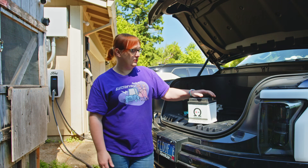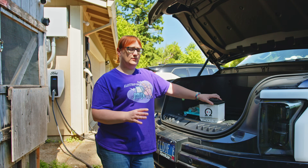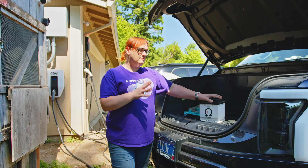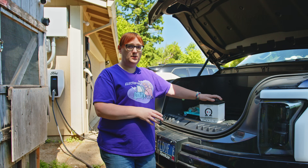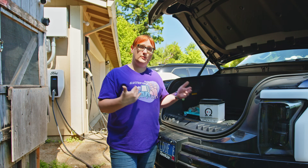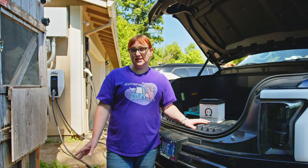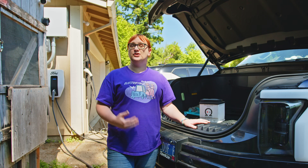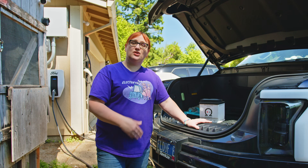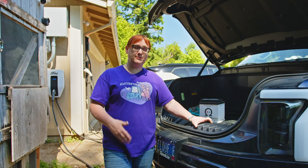It is unfortunate and frustrating that this battery died so quickly. I've also noticed a few strange quirks with this truck's 12-volt system — there have been a couple of occasions where I've got behind the wheel and the battery was in battery saver mode, suggesting it was low. I think what happened in those situations was that I'd come outside, opened the truck, turned it on to check for a download or do something inside without unplugging it, then locked it up and walked away — and the system hadn't properly gone back to sleep and had slowly drained the battery.